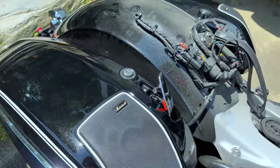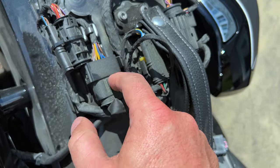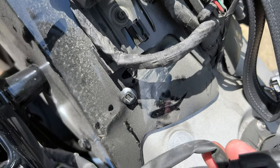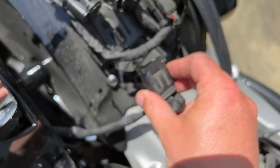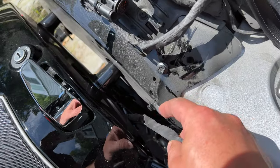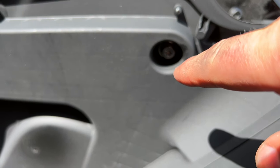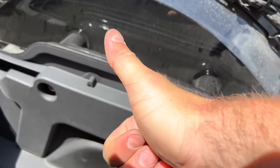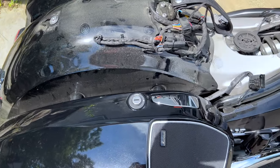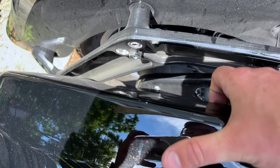You'll be left with a mess of coils. We're going to disconnect the yellow and blue connector right here, cutting those zip ties and disconnecting this piece with the two clips inside using your fingers. Then put a pick in from the top down, oriented back to front, to free that connector. Once that's free, use a T40 to remove the side bag bolts located right here. Put your leg on the bag from the outside and start unscrewing — those bolts are not encapsulated with any Loctite.